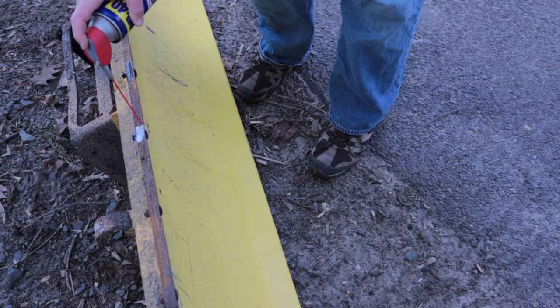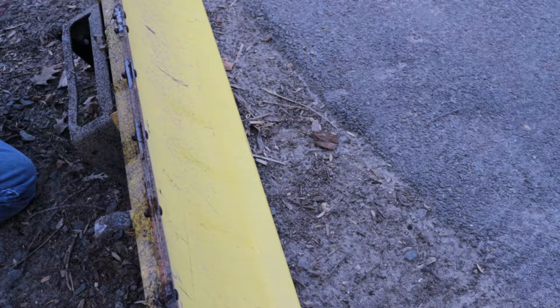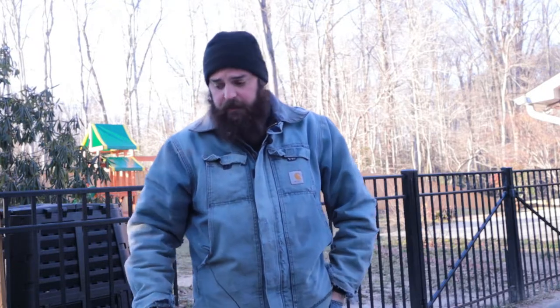This impact I have — that's not good enough. I might have to go get an air impact. I might buy the Harbor Freight one; the reviews on the Earthquake are pretty good. So we'll try the WD-40, let it sit, and see if it works. If not, we'll try some heat with the torch — see if differential heating helps bust them apart. And if not, we either buy an angle grinder or an air impact to run with the compressor, which might have a little more horsepower than this DeWalt. Or we'll buy them both — who knows?